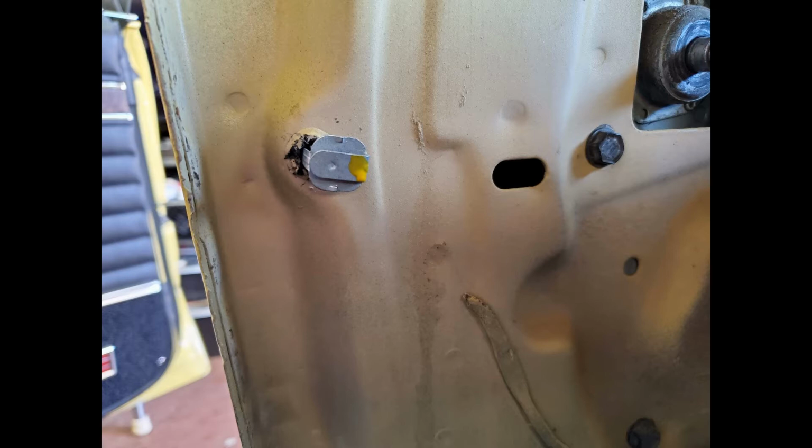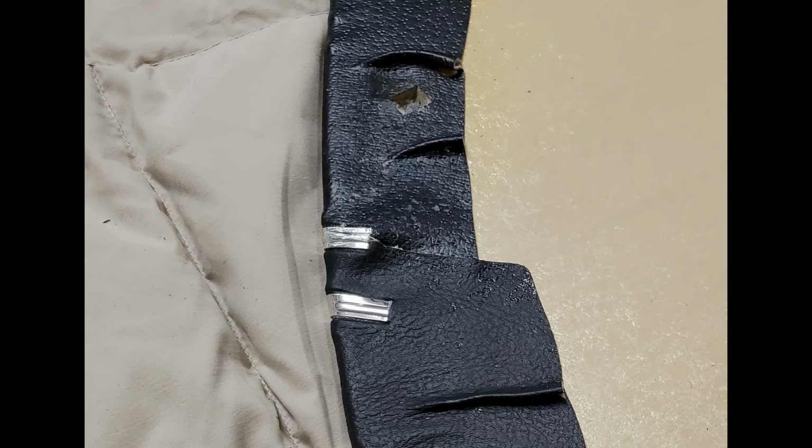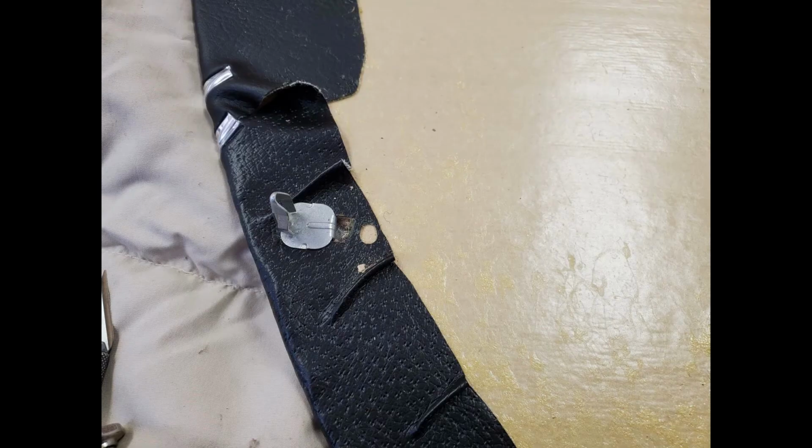Insert the tabs on the highest receptacle on the front and back of the door, and then place a drop of paint on the back of the tab. Now set the door panel in place and press the door panel against the tab to transfer the paint onto the panel. Now cut a small hole where the mark is, just big enough to be able to slide the tab into the hole, and then push the tab forward.